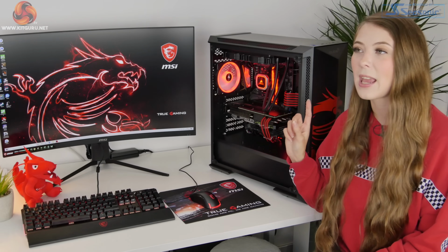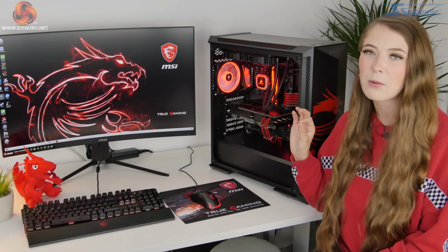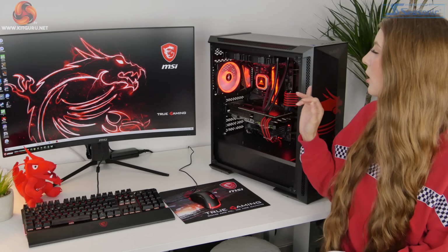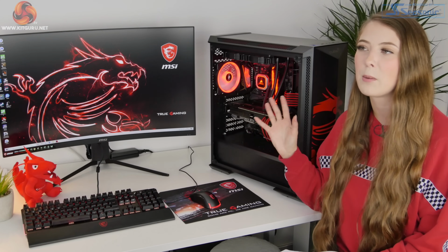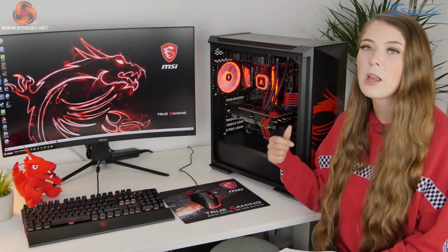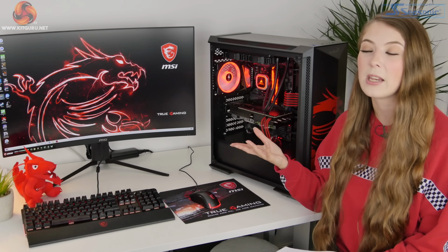However, because it is a high-end system, I am going to nitpick it because it is an expensive system, and for that price tag I'd expect everything to be perfect really. I mean, they're allowed to slip on a couple of areas, but there's a few things I would definitely change. So in particular, the red RGB fans, they're LL120s. I think the money spent on those could definitely be better spent on something like the RAM, more of it, or faster RAM. They are very expensive fans, and you could just put in static red LED fans and basically get the same effect as you're getting now.